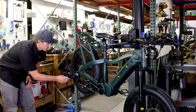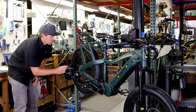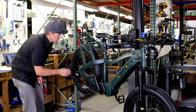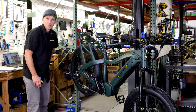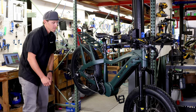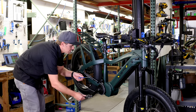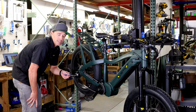I want to have a nice clean visual inspection — make sure that there's no damage, rocks, bends, or kinks to the derailleur. I can also at the same time check out the cassette. Just by moving it nice and gently, I can pedal it forward. I'm just looking for any visible damage in the cogs of the cassette — make sure that nothing is cracked, broken, dented, or damaged. As we keep moving through here, we're gonna look at the chain, just inspecting it for any damage, as sometimes these chains can get bent, kinked, or damaged.